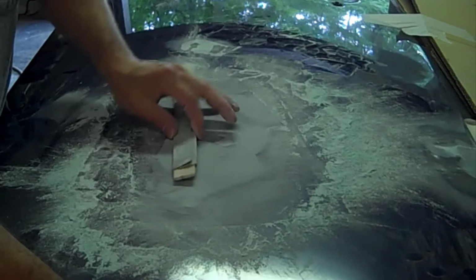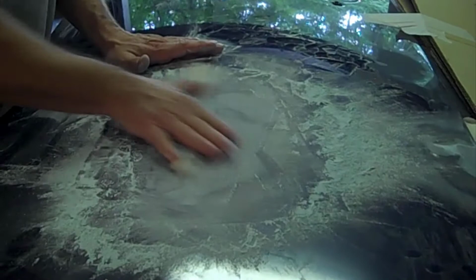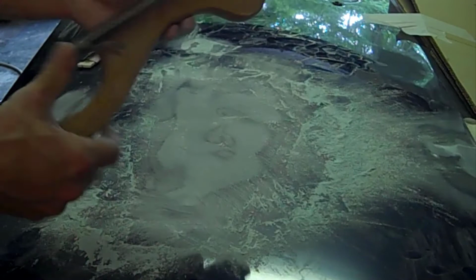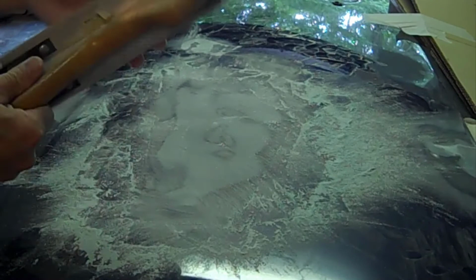The myth that the rougher the paper, the faster and better it's going to cut isn't true. Sometimes, when you get more of a flat surface, the finer paper will actually level it off better. So we'll jump to a 120, and I'll put it on a sweat board. This is a smaller, what some people term as a sweat board. They make them longer and longer, and this paper comes in a roll. This is 120. It's a really aggressive paper.